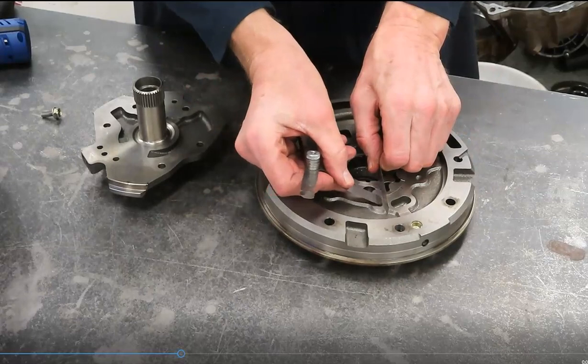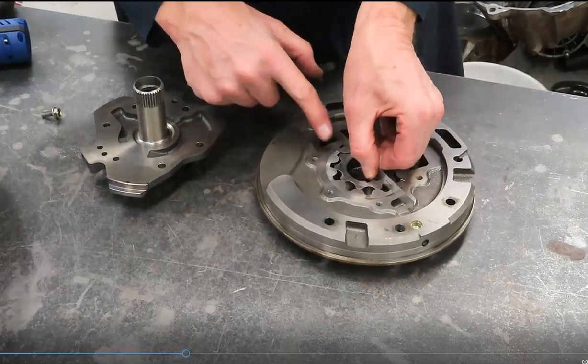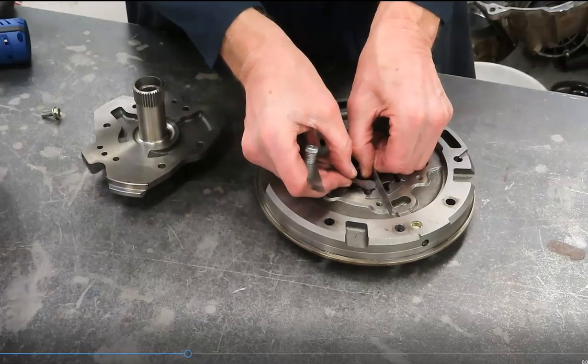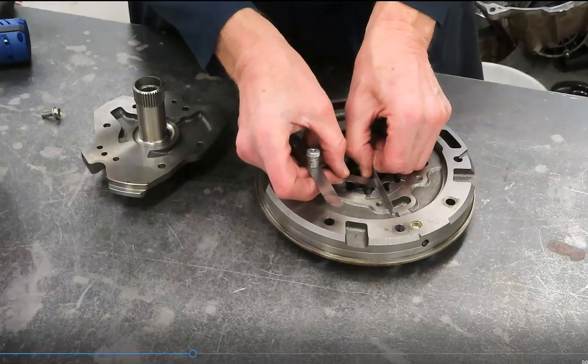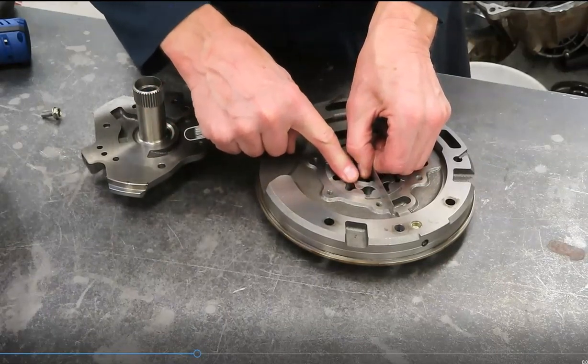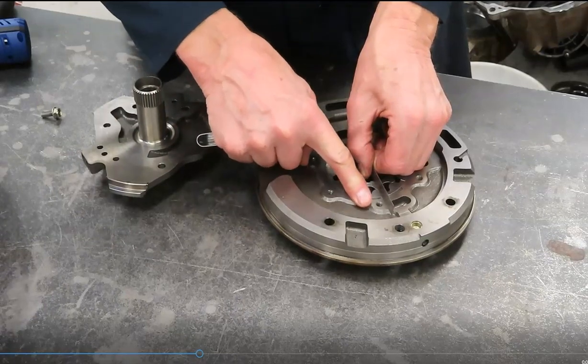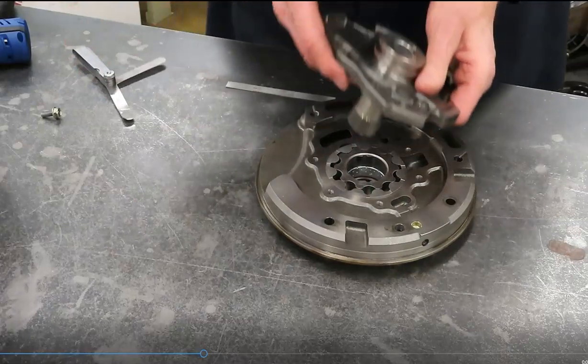Out here, we're not going to fit anything because that's resting on the edge of the pump. But here on the face of the gear, the side clearance, pump gear side clearance might also be a term they use. Rotor side clearance to pump housing. Okay, enough of the G rotor.